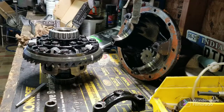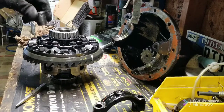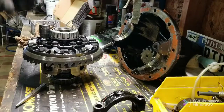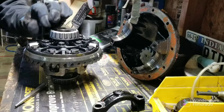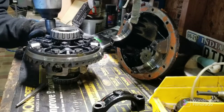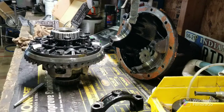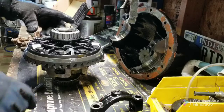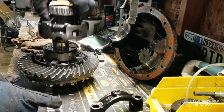Clearly I ramble on. Obviously I don't rehearse or script or plan my videos out, but I like to share the stuff I do with you out in my shop. So you don't have to take the ring gear off — this is a V6 third, and it unbolts and comes apart in two pieces. The four-cylinder ones are tougher; you have to take the ring gear off and pull pieces out of the middle. The V6 ones are real nice because they bolt together.